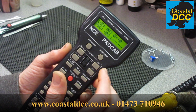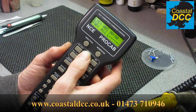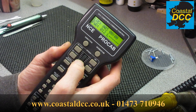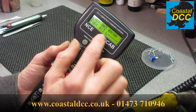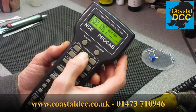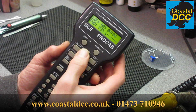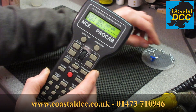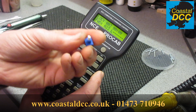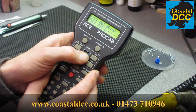What occurs with the thumb wheel is the speed becomes erratic at times and it will jump around. As I scroll up it should go up nicely, but as you can see on the dial things are not going as they should. If I scroll back down again it's going up rather than down. That's an indication that the little encoder attached to the thumb wheel has failed or is on its way out.